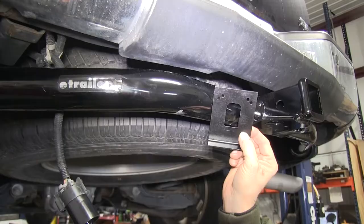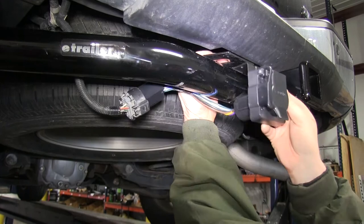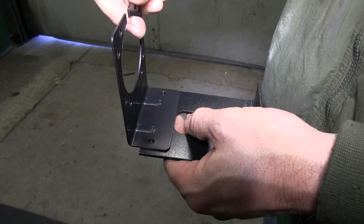Now we need to attach it to our hitch. The bracket we're going to use to attach it to the hitch is part number 18140, and we'll use that with the mounting bracket that comes with the trailer connector. After a test fit you can see that bracket is a little bit on the short side, so we're going to take the bracket down and use our seven-pole bracket to mark and drill a couple of holes towards the end to give us enough clearance.